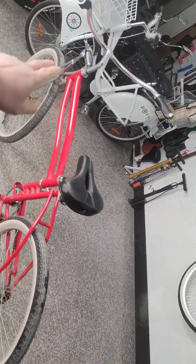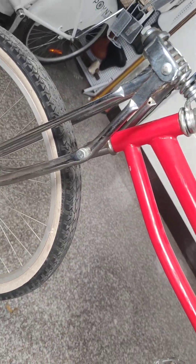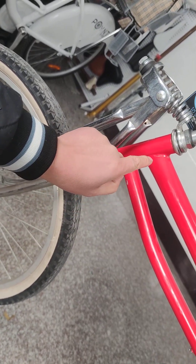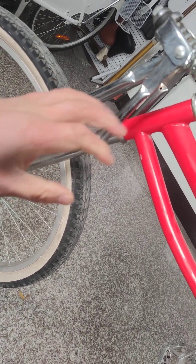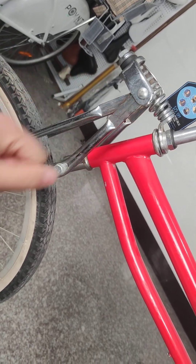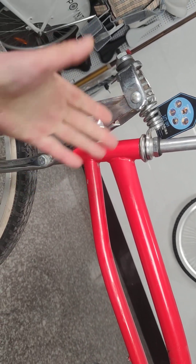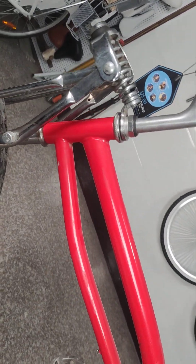This is simply the application — we have the Ranger fork installed on the bike. It's quite easy; you can actually upgrade your bike with a fork like this. Your head tube has to be 90 to 120 millimeters, because we have the steering tube at 160 millimeters.